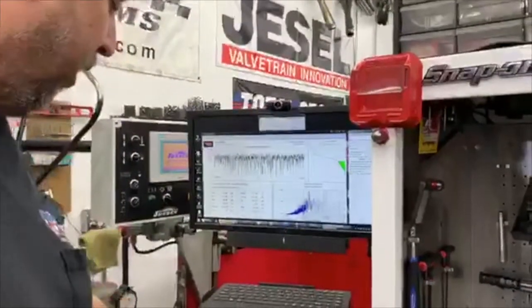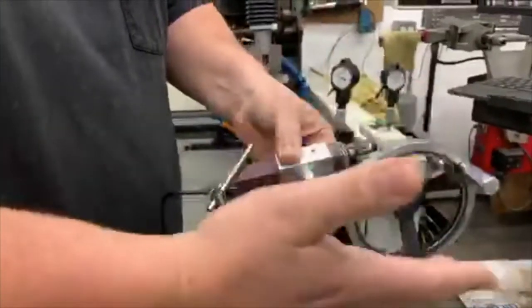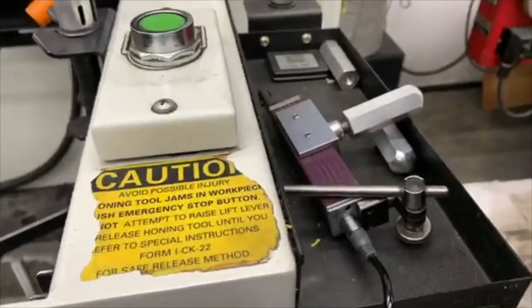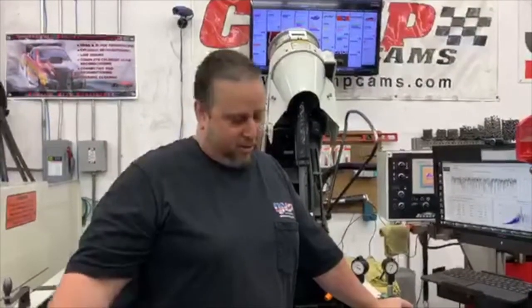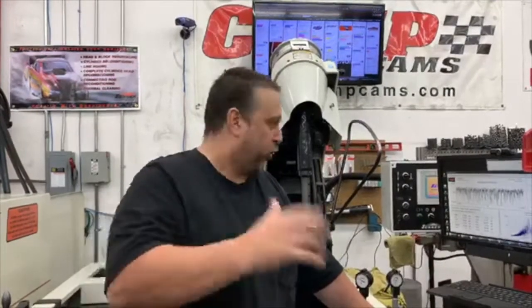I put the profilometer in the bore with my trusty clamp and the thing works fantastic - it moves automatically so I don't have to mess with it. That way I can test it in three or four spots per cylinder to get an average. Because when you trace the cylinder, you can't just check it in one spot - it's kind of like trying to measure a bore with a dial bore gauge in only one location. It doesn't tell you the whole story. Multiple points of data gets you a clearer picture. I do it in four spots around the top because that's where the most important part is.